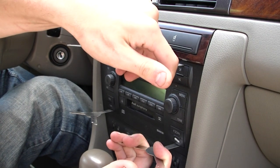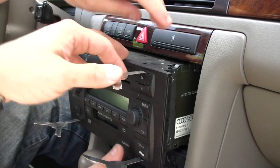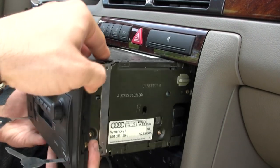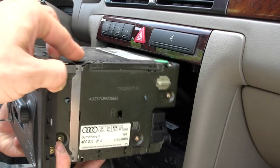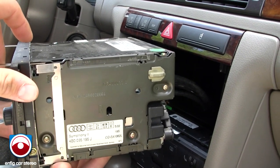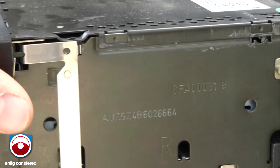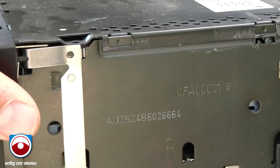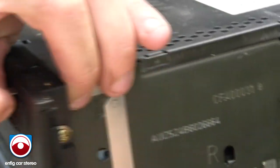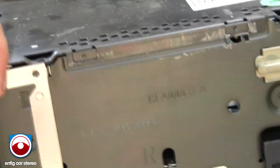Apply outward pressure while you pull. It doesn't always come out that easy. When it doesn't, you've got to push it outward. If you look at the clips holding the radio, tilt it on a corner angle a little more — there you go. See those little clips? When you apply pressure like that it pulls them back. That's the same way you release them. You just push in the clip — it's hard to do with one hand. Put the radio back in.